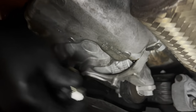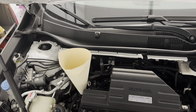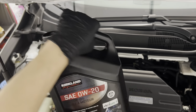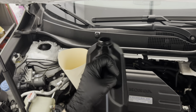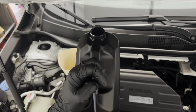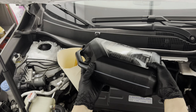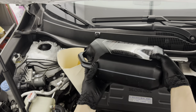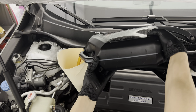Make sure I don't lose that washer — yeah, a few drops. Ready to fill. I have about 3.2 to 3.3 liters measured out in this Kirkland full synthetic bottle. I have a few bottles of this. Basically I measured it out — just a little bit over 3 liters because I put some into the oil filter, so I just want to be safe. Don't overfill the engine. You can see the nice golden fresh synthetic oil pouring in.